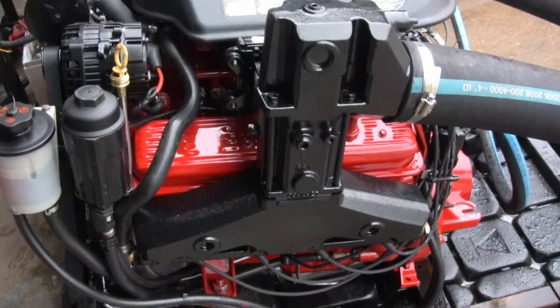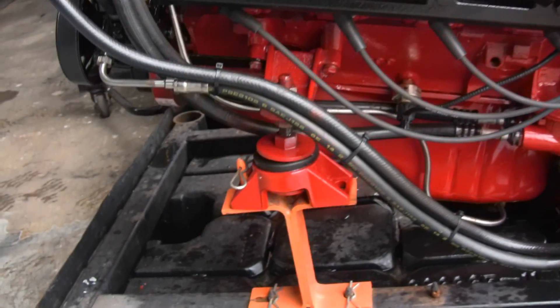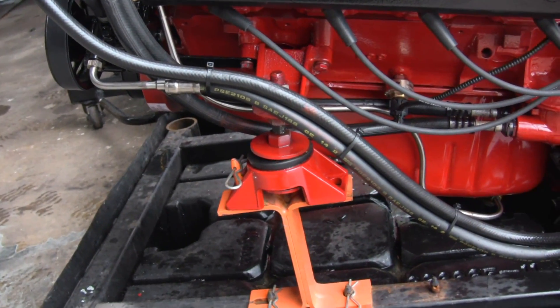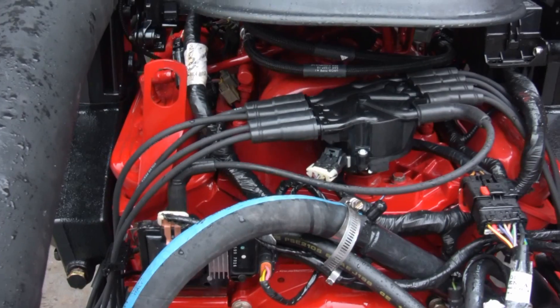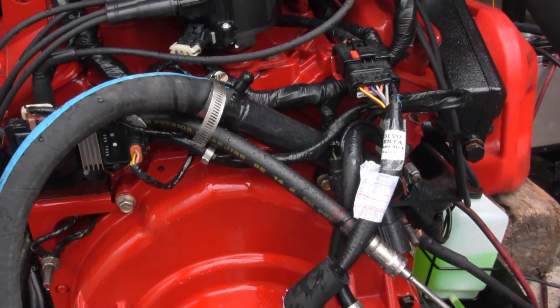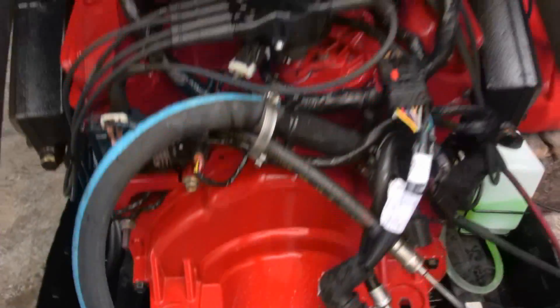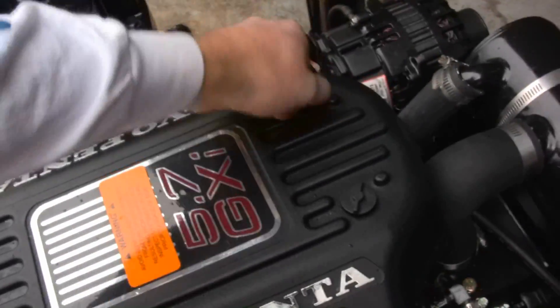Cleaned up your wire harness. New manifolds and these are the tall risers on here. There's one of the new motor mounts — like I said, I just did the one side; the other side I just blasted, cleaned it up, and repainted it. I did do a tune-up kit — cap and rotor. You saw the old plug wires; this has got new plug wires on it. Coil and the coil driver module all checked out okay, so we reused those. Your power steering cooler — that was fine so we reused that. Bell housing coupler — that was fine. Relays and everything else are good, so there's no reason to replace any of that.